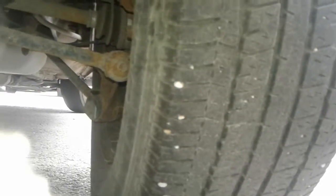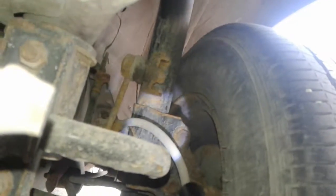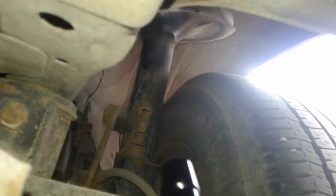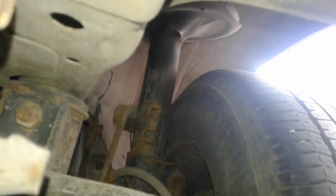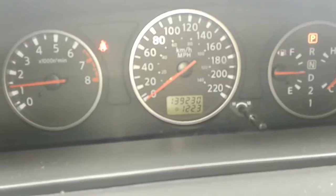Like I say, you could do the summer with it, but I would definitely be trying to negotiate a set of tires there. Now, on this one here, the strut is dry. If you see that shaft, that strut is dry. So the right rear strut is fine. Left one is not. However, I would negotiate both struts, because if one's gone, the other one's not far behind it. So about $600 you have to negotiate into the price for rear struts.